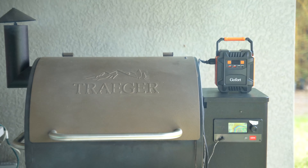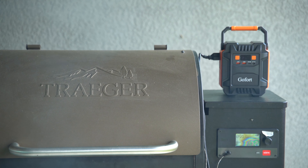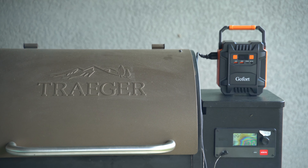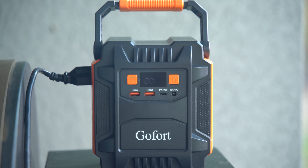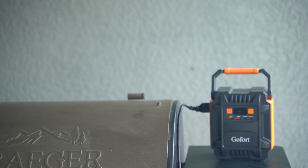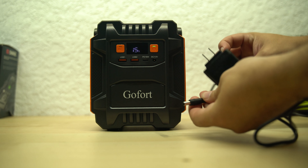In about 5 minutes the grill started smoking, so it's turning on. You can see the temperature rising on the grill display. So yes, it can turn on the grill. Once the grill is fully heated to the set temperature, it actually takes barely any energy to keep it on. But as you can see on the battery display, we have 20% battery left and we started off with 46%, so it does take a big hit on that initial ignition. But once the grill reaches your desired temperature and you start with a full battery, I estimate you can use this for about 30 to 40 minutes, which is enough time to cook a small meal.